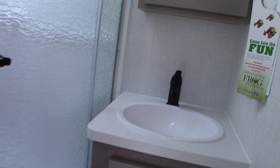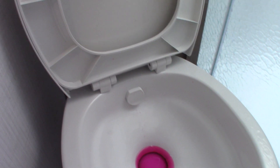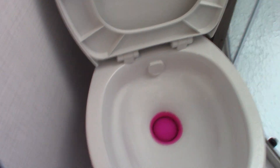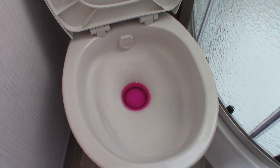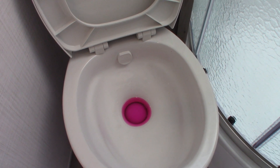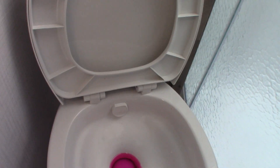When it comes to your bathroom, the toilet works like any RV toilet. It sits over a black tank — you just have to remember you can't use it dry. When you first get to the campground, hook up your power and your water, then put a dose of chemical in there and step on the flush pedal. Hold it down until at least a gallon of water and the chemical go into the black tank below. You can use more water, just not less. If you use it dry, the smell will be terrible and it will get clogged up. Always want water and chemical in there — at least a gallon.